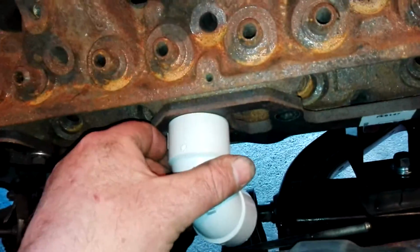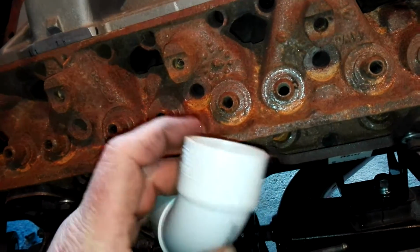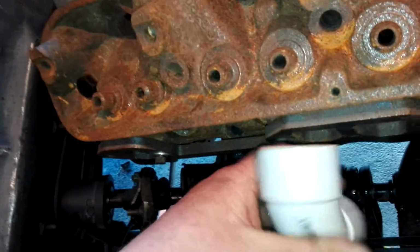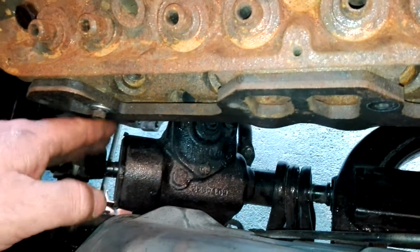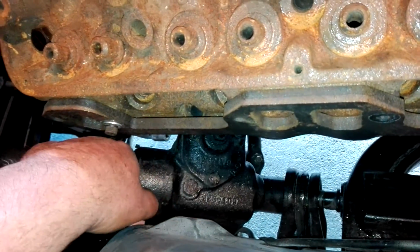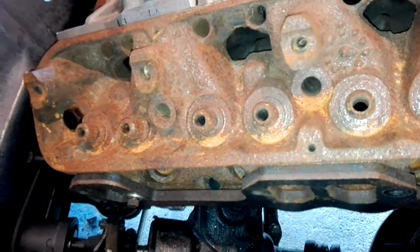But on this side, that's going to be pretty tight. But I can quite easily chop 10 mil or half an inch or whatever off these. It's not going to matter much. It still gives me plenty of room to slide a wee bit of pipe in there. But we'll end up hopefully snaking a set of. I'm going to try and make on this side a set of 4 into 2 and then into 1 further back if I can. That would be sort of ideal because I'm going to easily get that on the other side.